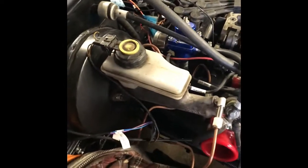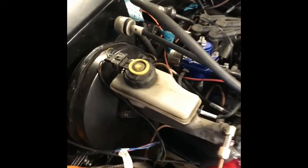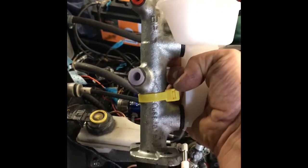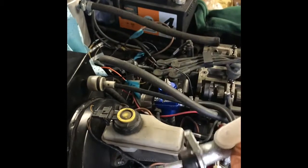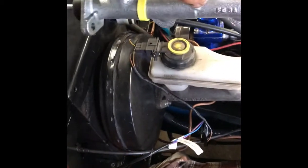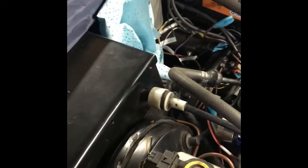So at the moment I'm looking at actually changing the master cylinder - taking the servo off, which I'm not keen on as I do like the feel of it, but it's something I'm going to have to sacrifice and give a go. I'm going to try not to destroy anything so if I need to go back to the same servo I can. I'll try fitting adapter plates where necessary to mount something different. What I've come up with is an original Mini master cylinder conversion - I believe these were used on original Minis, mounted like that, hence why it's got a reservoir cap on top.